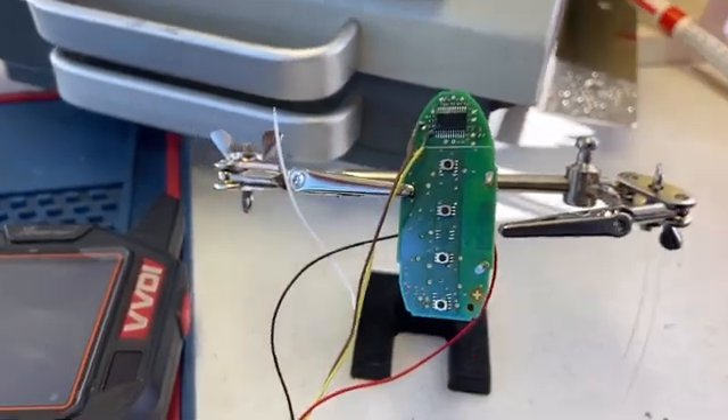Here's another aftermarket smart key — this one's also an AES type. Same principle: connect the brown wire to pin 26 and the yellow wire to pin 25. Follow the traces on the board — this little box would be pin 26 and then 25 would be the next one. Connect the brown cable to pin 26 and the yellow to pin 25; you can see the traces leading to each pin.